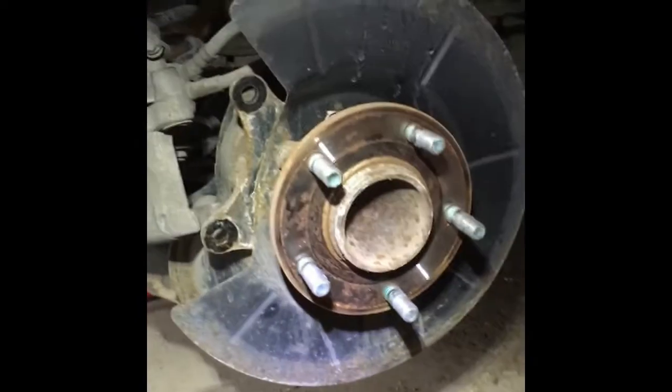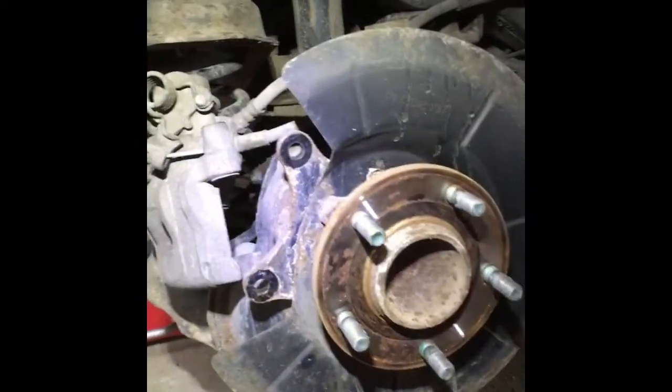So there was also this guy, right? I need to take down with these 13mm screws. I will use the anti-seize on these two. Same with these Allen pattern 7mm bolts too. So I'll put it on the threads, and then I can put a new rotor on. That would be it.